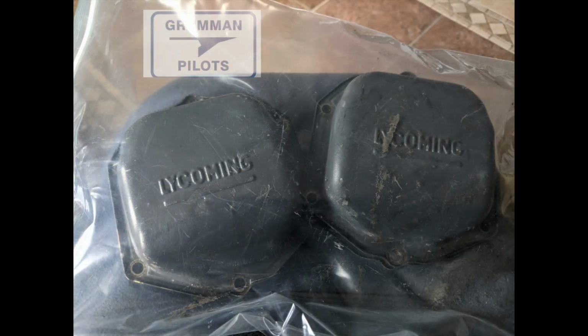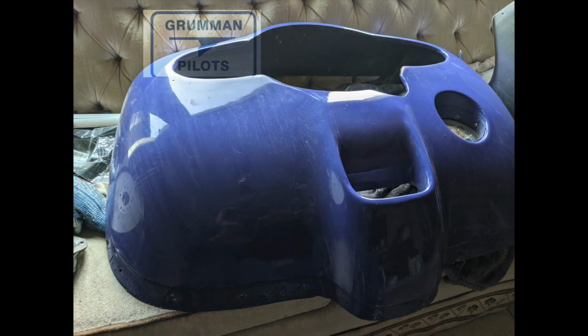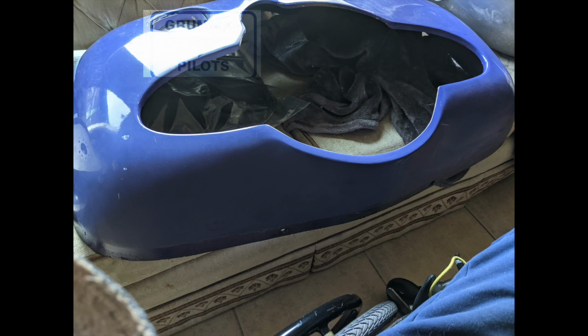Now, you may have noticed in their red and their yellow product that was rotating, that if you looked in the inlet, you could see rocker covers for the various engines. One said Franklin. I couldn't read the other one. But anyway, in our nosebowl, we're just going to have the bracket air filter screen guard down in the bottom, the landing lights in the nosebowl, a rocker cover on either side, and then a spinner that is going to be part of the assembly along with a spinner backplate.